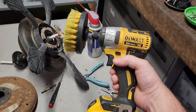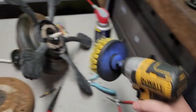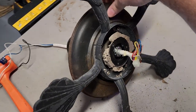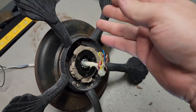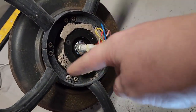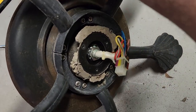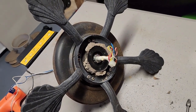We're going to clean the mud out. I've got my Dewalt right here with the brush. One of the things I do before I paint this guy — you see it's got this beauty ring floating around right here. The most correct thing is to take off each of these leaves — two fasteners and it's going to pop right off, allowing me to separate the beauty ring so I can get a good inner coating.